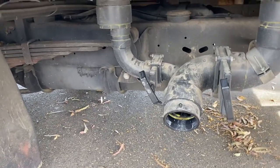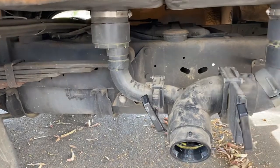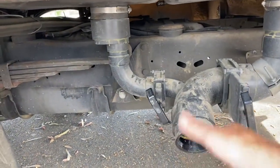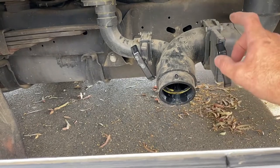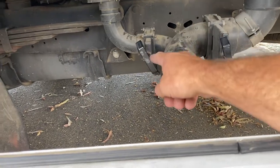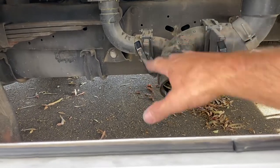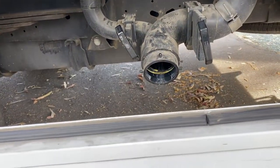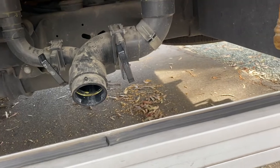This compartment is where you dump your sewer water and your shower sink water. The big pipe is called black water, and the small pipe is called gray — toilet, shower, and sinks. You'll take the hose from the back, connect it underneath here. Open up your black, wait for it to audibly stop draining, then pull this gray valve and let it all flush out. Push both of them back in, take your hose off. When you're dumping there's generally a hose to drain and clean it. Dump it back in the sewer. Please don't dump it on the roads or anywhere else. Then put the hose back in the compartment.